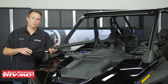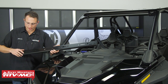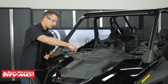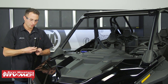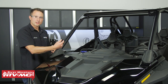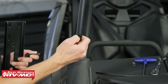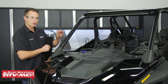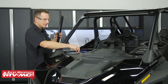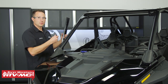Now we can install the front cross member. This is the wider cross member and we're going to install it so both edges are facing down. The front edge has slots on each side. When you install this, you're going to use your 55mm bolts — each bolt is going to have a washer, and that applies to all of the bolts in this kit. Keep in mind we're going to go through this one-inch spacer, which is the midsize spacer in your kit — you have more of these than any other one. These are the longest bolts. We'll go through there with that spacer in between the roof and the roll cage, and then on the back side of every bolt you're going to install a nylock nut. Throughout the process, leave everything loose until we make some adjustments later on.